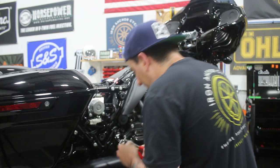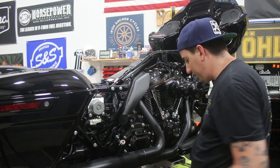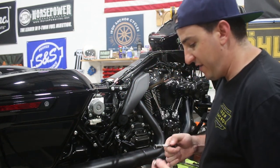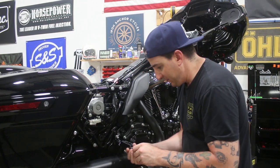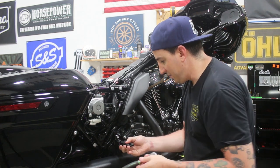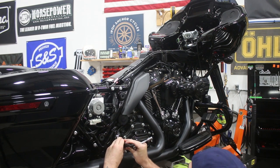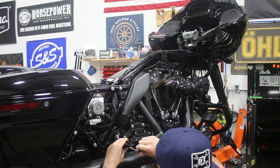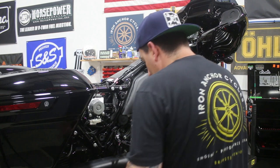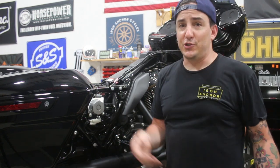I'm going to grab snap ring pliers and put that on. Just make sure that's fully seated in that groove so it's locked in place. Now we're going to grab the peg, slide that on, and with a little bit of Loctite on the ARP fastener, go ahead and install that through the peg. Now obviously what you want to do is check your alignment and make sure this is how you want it — ideally flat. Those are going to be your rear pegs. We're going to do the same thing on the other side — I won't show that because it's exactly the same — and then we'll just move up to the front and get started on that.